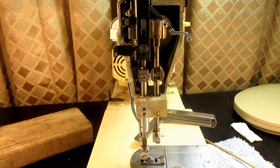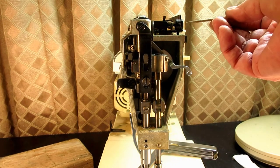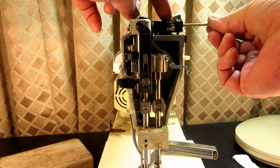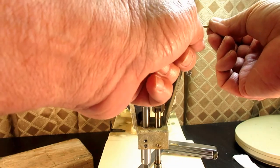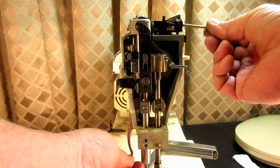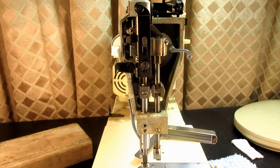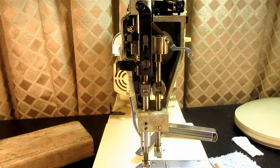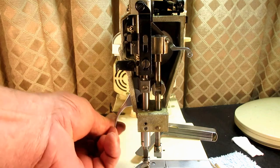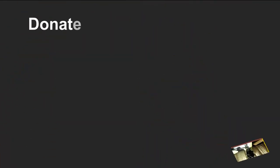Make sure it's moving the tension lever — when I lift the lever it'll push on the tension pin. Normally you'd have the tension unit here; I've got it out because I took the cover off so you can see more. Thanks for tuning in to the presser bar system of a Singer Model 353 Genie — Benny's coming along. Hope you can tune in next time, take care.